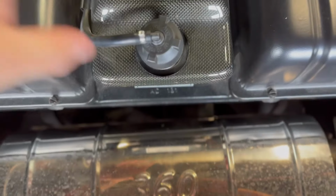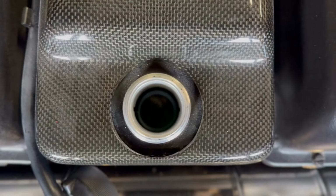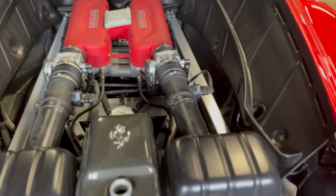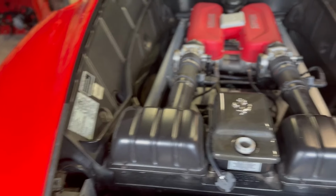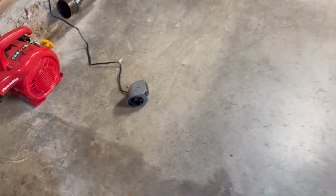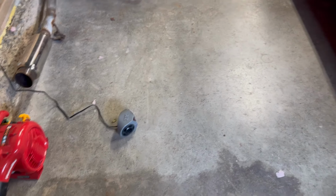Let's do this. Take a look at the coolant, make sure it's good. Well, there's no flash there, but I think it looks decent. Same as how I left it. Doesn't look like it leaked. So I'm just gonna do a quick once around in the engine bay. Once I start it, I'll check the oil level once it gets up to temp and go through the rounds. I also put fuel stabilizer in it all winter with a full tank, so that should hopefully have worked. I also had a noise maker going for rodents to make sure they stay away. I've heard mixed reviews about these, but I haven't seen any signs of rodents.